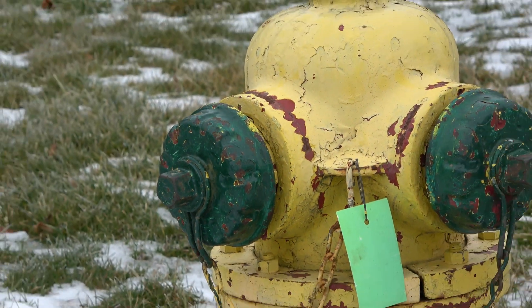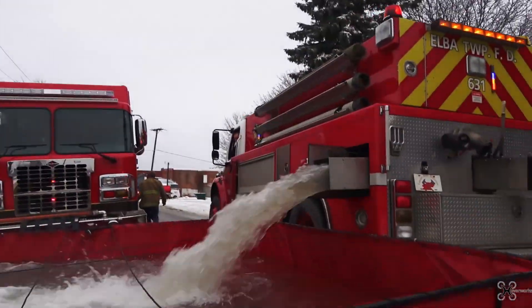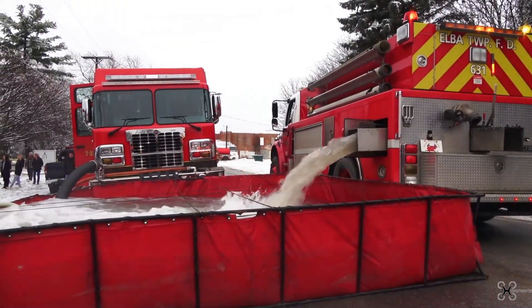This is typically no big deal when connected to a pressurized fire hydrant. But as mentioned earlier, the vast majority of the country has no hydrants. Rural fire departments bring their own water. A city truck may only have a couple hundred gallons on board, as they expect to connect quickly to a fire hydrant. Rural fire departments, on the other hand, typically carry at least a thousand gallons — many fire engines even carry up to 2,000. This water is heavy, and the tank size is a trade-off: bigger tanks carry more water but make the truck heavier, taller, less mobile, and more difficult to get to the places it needs to go.